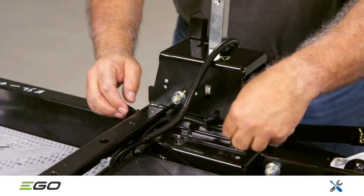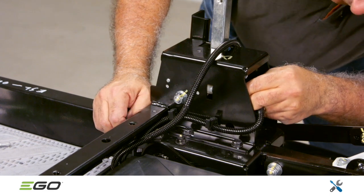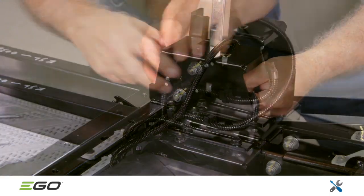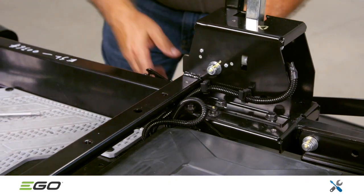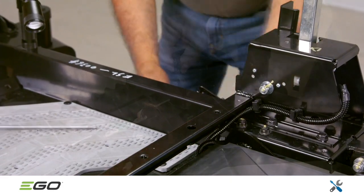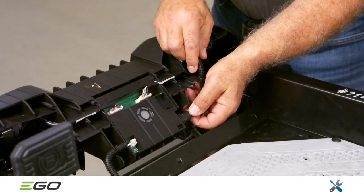Route the flexible hose wires to the right and left steering lever bases. Apply dielectric waterproof grease to the Type-C plugs and replace the rubber cover before plugging them in. The longest flexible hose wire goes to the front frame. Secure this wire in the 5 hooks under the mower frame and the 1 on top. Apply dielectric waterproof grease before plugging in the Type-C plug.